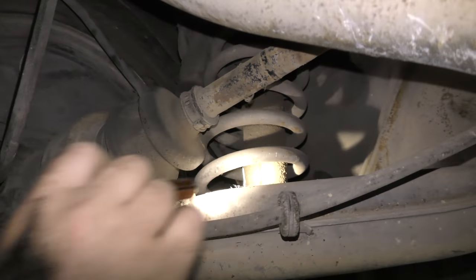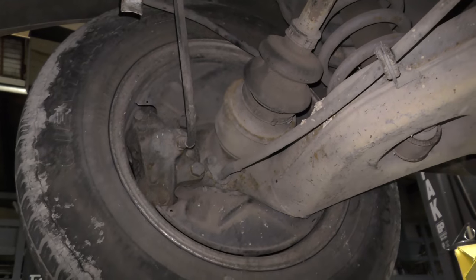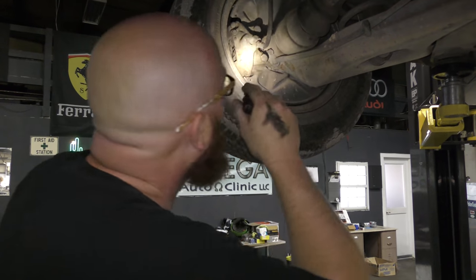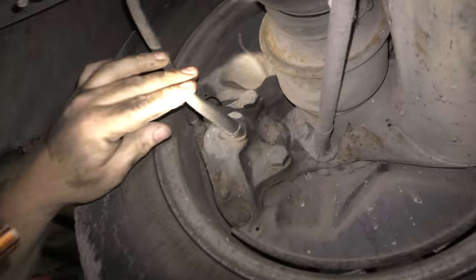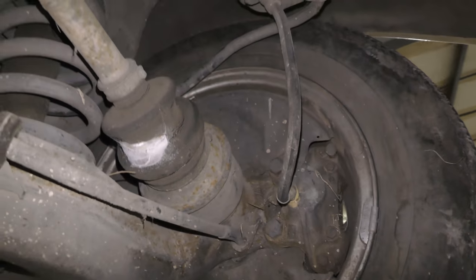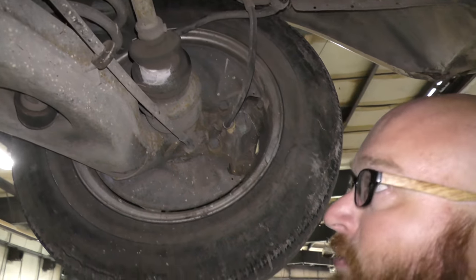While we're here, let's check the sway bar link — yep, you don't want to hear that in a nice Mercedes going down the road. You need sway bar links. The brake pads — I'm not even going to check the condition. With the age of this vehicle, it's going to get all new brake pads all the way around for safety. We don't need to run on seven or ten year old brake pads. The brake hoses have a lot of dry rot in them — that is not good. We're getting new brake hoses. Both sway bar links are bad.